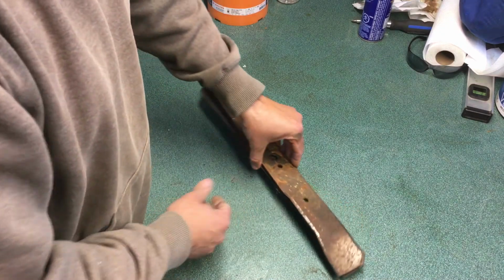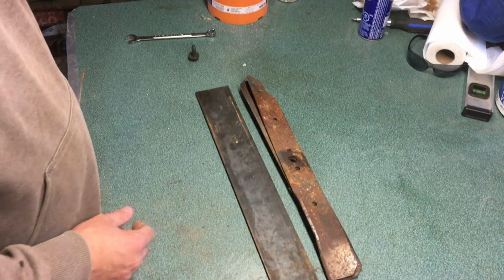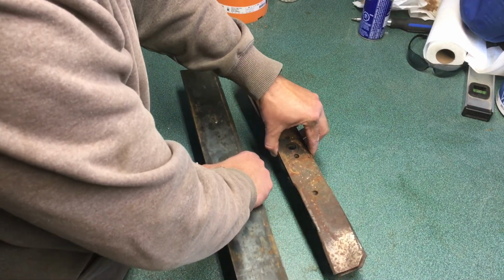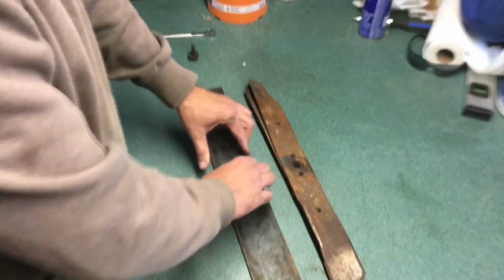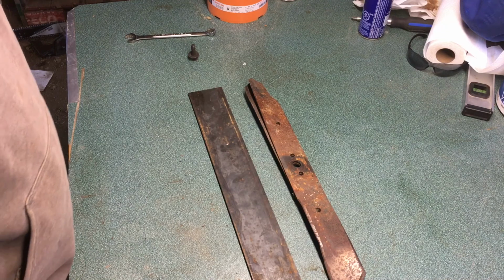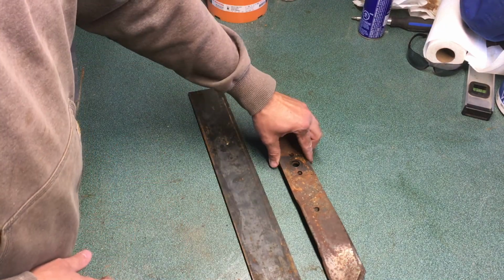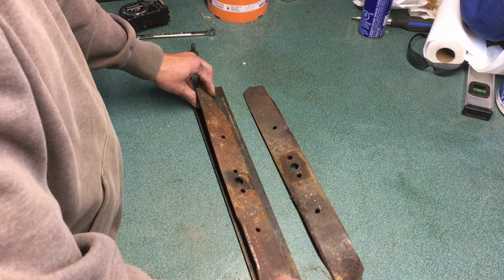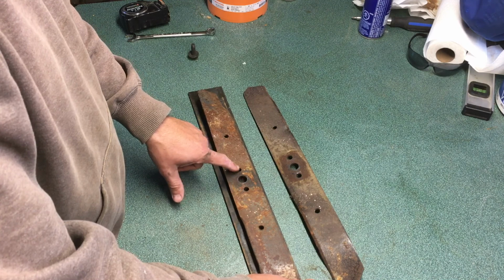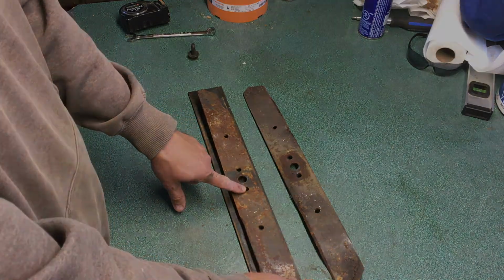So what I'm planning on doing is replacing them with this. Initially we're just starting off, and it's not that much heavier, but it is heavier. It's essentially just a 1/4 inch piece of 3-inch flat bar cut to 21 inches long. The biggest concern I have, obviously, is getting the center correct. So we're gonna have to measure exactly center for the center hole, and we're gonna try to cut out 2 cutouts for these little indents that are on the machine.